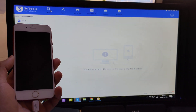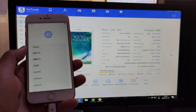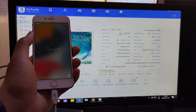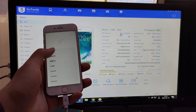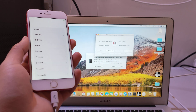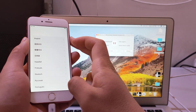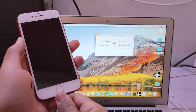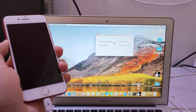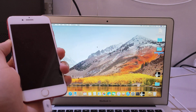Now the flash is completed. It's all done — the flash is done. It's the last iOS version, iOS 15.4.1. Now we connect the phone to the MacBook. Now enter the phone into the DFU mode. Close the tool and re-open it again to do the restore.